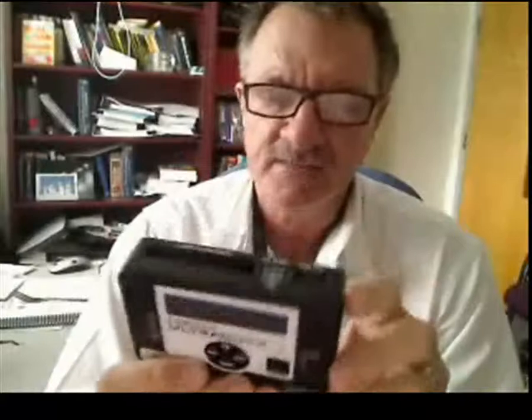One of the things you want to make note of is the information on the hard drive — the hard drive size, the type of connections used, and the serial number. All those things are important for your chain of custody form so you can make sure you're working with the correct drive and show it's been handled appropriately. Also on the UltraDoc, it's a good idea to write down not only that it's a Forensics UltraDoc version 5, but also the serial number and model number on the back.